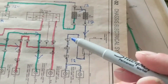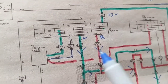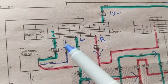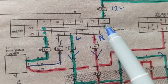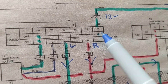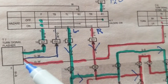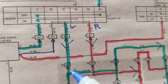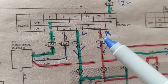Now we have something called combination switches. Toyota is big on these. These switches are used for lighting and other accessories. When you see these, it's like a jumper wire from terminal F to terminal B1 — wherever there is a connection shown, that means it is connected to that terminal. A connection here means connected to this one; a connection there means connected to that one but not this one, and so on for TB and the left and right positions.